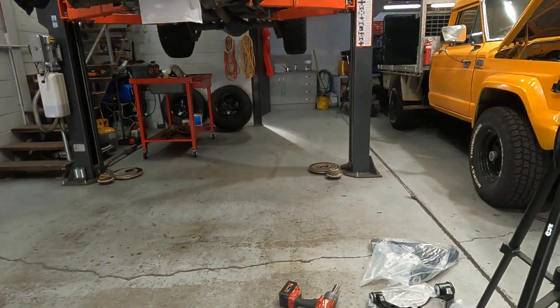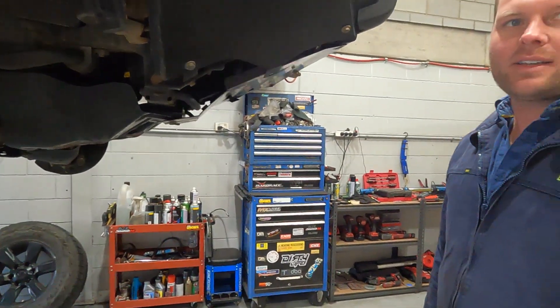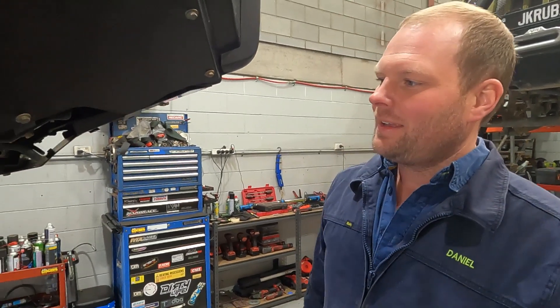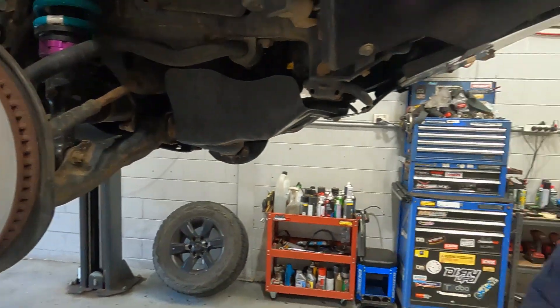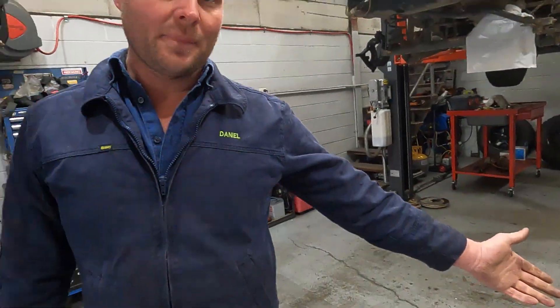You were giving it a bit of heat and a bit of smashing on that particular joint - they're already pressed into the new arms as you can see. So all the pain getting the old ones out - that's the way you normally do it. Depending on the state of the vehicle, the kilometers it's done, the condition of everything, I do opt to put a set of lower arms in when doing a full suspension upgrade - it just makes sense nowadays. If the bushes are half worn and you've got a ball joint that needs replacing, the process to press these ball joints and bushes out and put new ones in is pretty lengthy. A complete control arm like this is really cost effective now. By the time you buy the bushes, the ball joint, and the labour involved, you may as well purchase an arm, take one out, bolt one in.